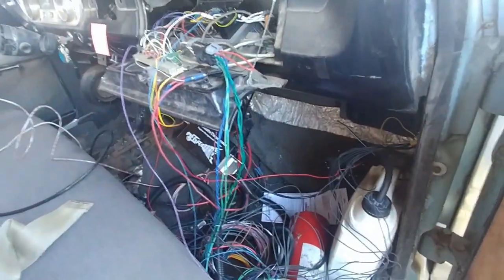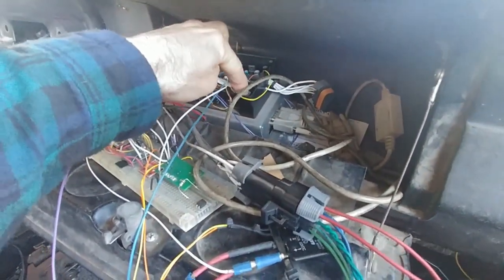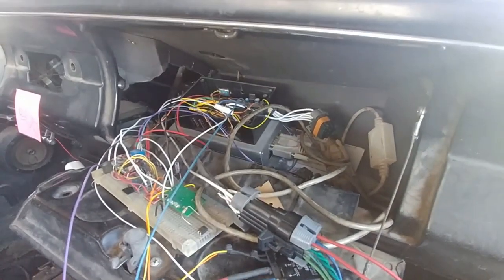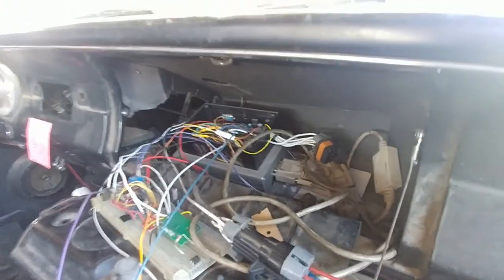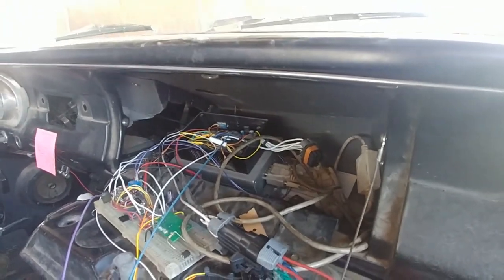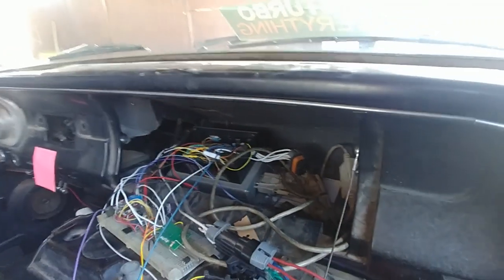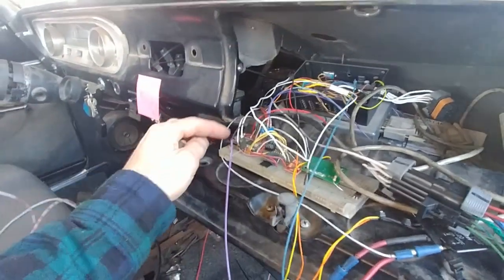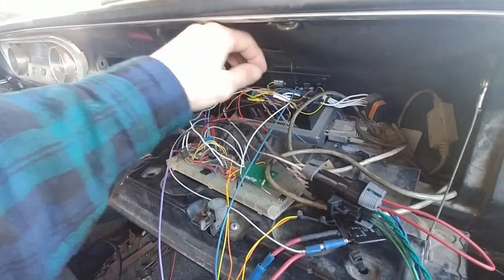There's a lot of wire here, let me explain what's going on. Inside here is my original transmission controller that I built using a PICaxe 20X2, my MegaSquirt 2 box down below - they're just kind of screwed together with wires run in between. I reused the internal VR sensor circuit to condition the Ford vehicle speed output, and it's bolted to the transmission. This cluster of wire on this breadboard is a Teensy 3.2 with a CAN bus transceiver.